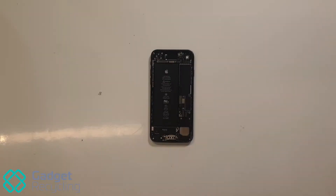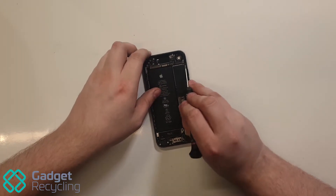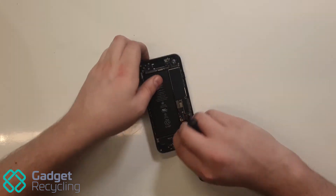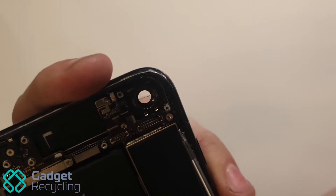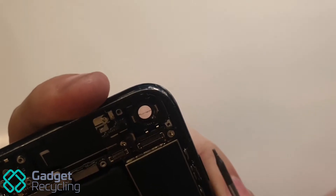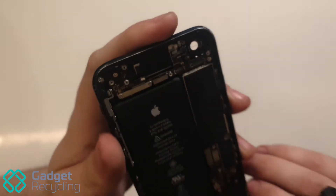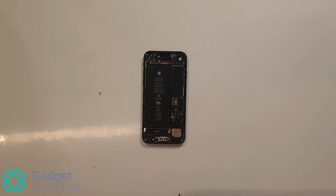Starting with simple contact shorts, these can cause the flow of energy to route in the wrong direction of the device, which results in no NFC. The major one to pay attention to is the alignment of the NFC flex that sits in the top right corner of the device. It needs to be sat upright relative to the back of the device. Anywhere towards the edge of the phone or the board will result in a loss of NFC as it will typically contact the back of the display.